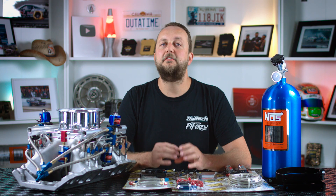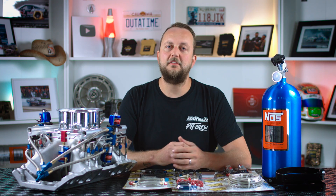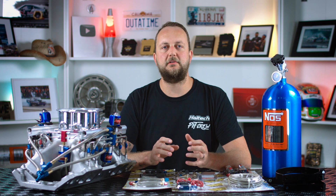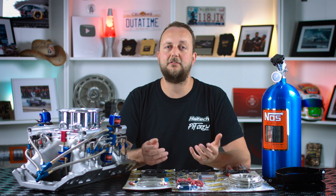So why don't we just inject pure oxygen? Well firstly, pure oxygen is pretty dangerous, and while it's not flammable itself, it does act as an oxidizer and make things a whole lot worse if a fire is present. Secondly, if you inject pure oxygen, you're displacing the nitrogen that we need to expand under the heat of combustion to make power. This results in ridiculously hot combustion temperatures, but with a lot less expansion, resulting in less torque and less power. The best way to make more power is to make the intake charge as dense with nitrogen and oxygen as possible. Enter nitrous oxide.